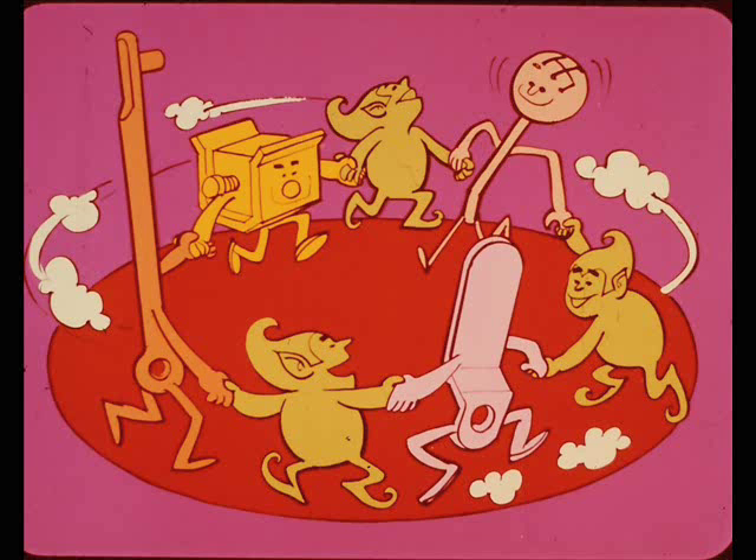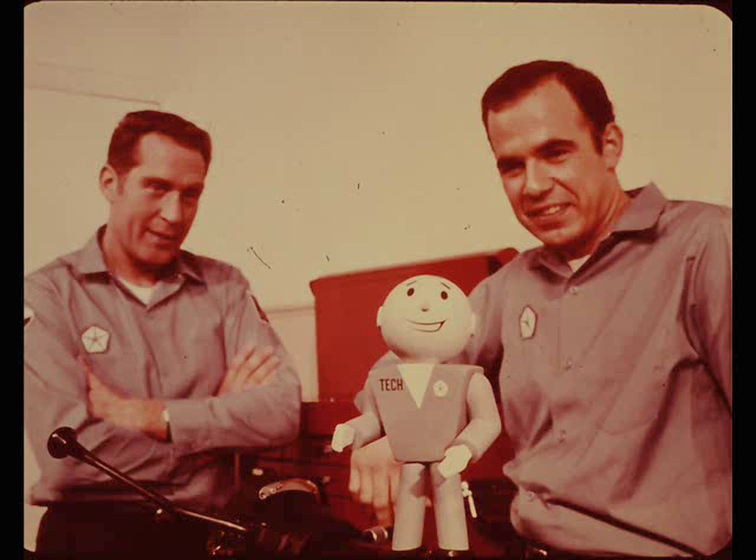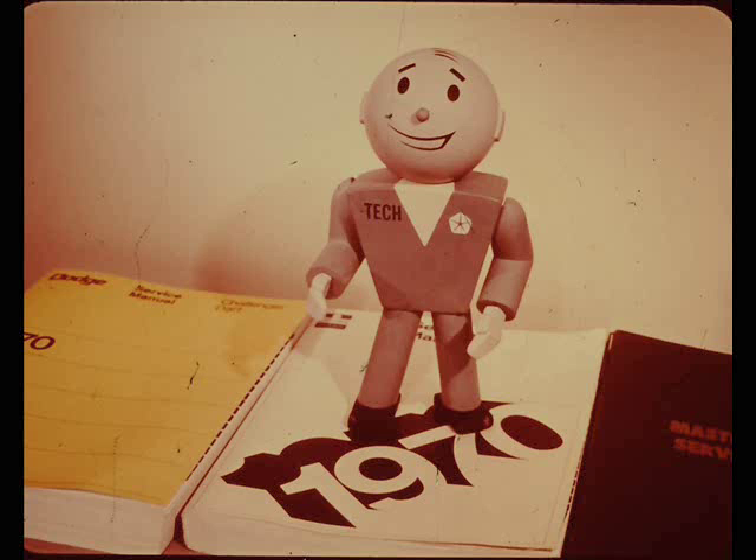I think I'm going to dream about rods and levers and swivels tonight. But now that I know what's inside the new steering column and have been introduced to all the linkage combinations, I'll know how to tackle a problem of a stuck ignition key. Shift linkages may not be the most exciting part of the car, but they are mighty important. The new locking steering column is a good feature, but it won't work if the shift linkage isn't adjusted right. If you'll use this month's reference book and your service manuals, you shouldn't have any trouble handling shift linkage problems and ignition keys that won't lock. See you all next month in Master Tech Color again, naturally.